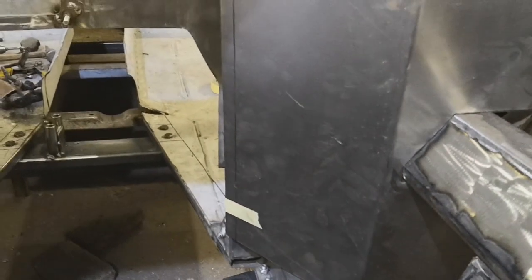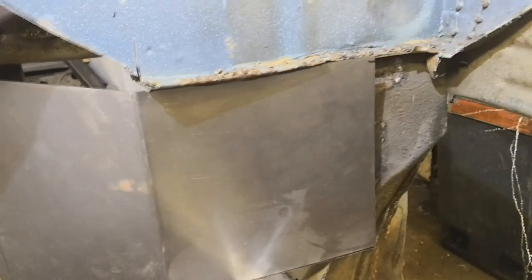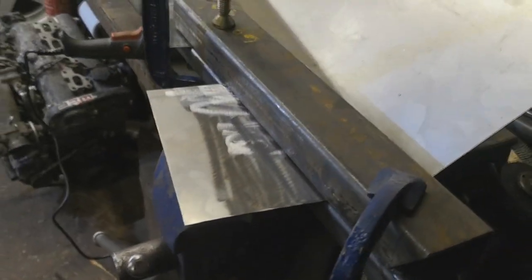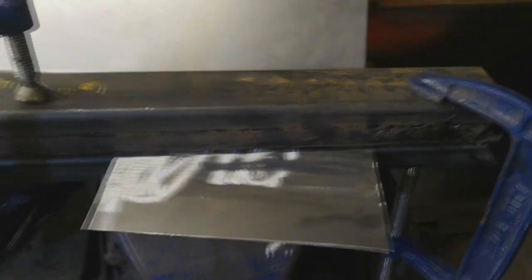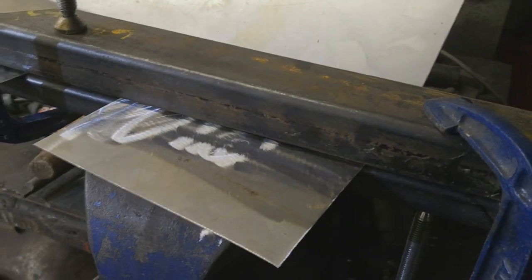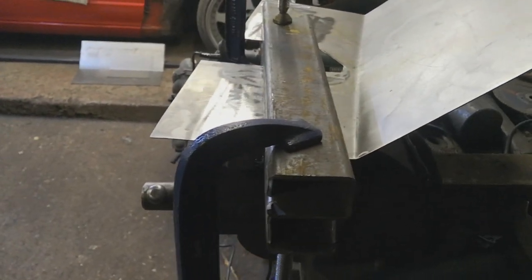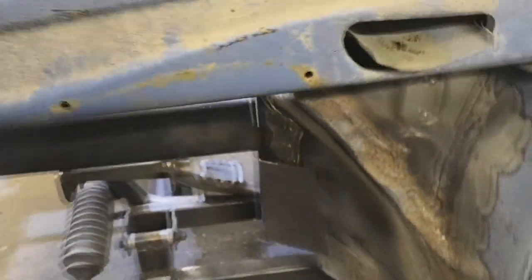First test fit of this panel - it's not too bad. I need to get it to fit a bit tighter up there and also trim along there. After a bit of tweaking I've managed to get it to fit quite well. I've got about a quarter-inch gap which will close up with a bit of a pull when I go to tack it. I need to give this panel a little bit of a fold where it goes back against the wheel well - the front inner arch. This is the only way I could think of doing it at home to get a semi-decent job.